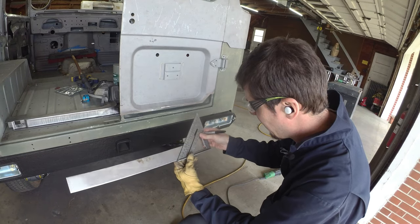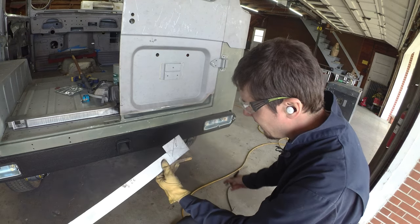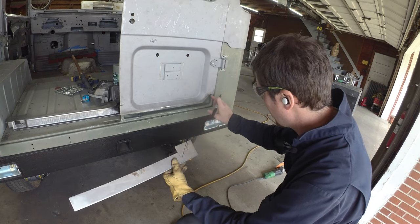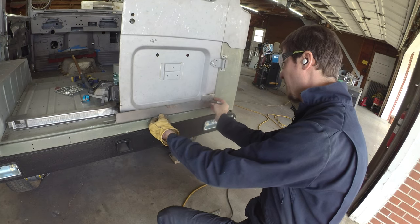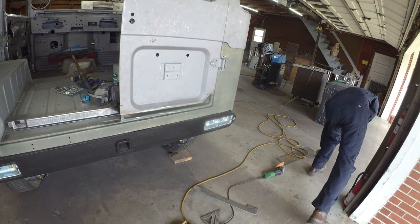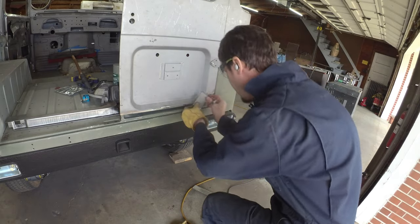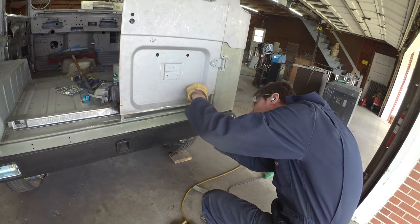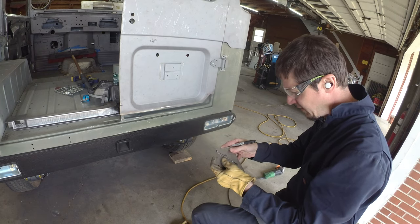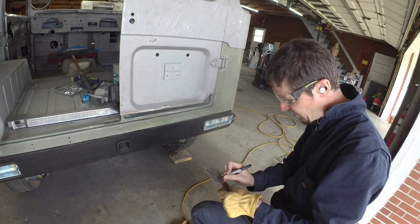So we can use our carpenter square here to give us a line up to that 45. And we want to cut everything above that line. But we do need to know how far to go. But it is a known distance. So if we grab a tape and measure that off, or really, the other cheater trick is if you've got anything that you could just mark, it would give you that length. That way you can translate it over. My tape measure is off somewhere and it's going to be a hard one to get a mark on anyway. So that should give us our mark as far as how far to bring that guy down.